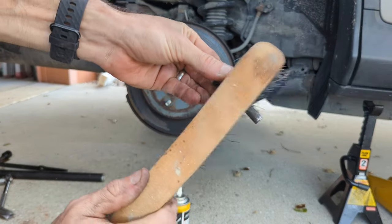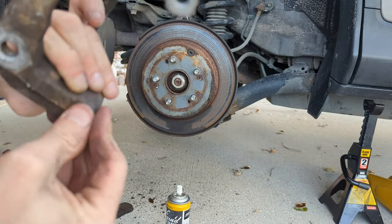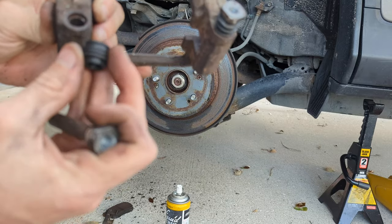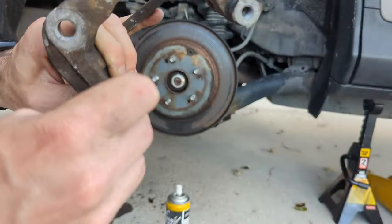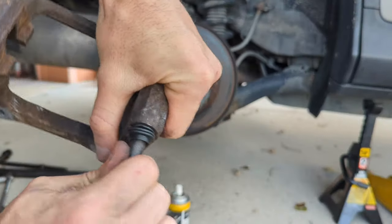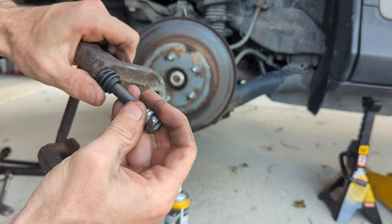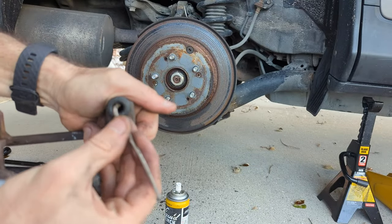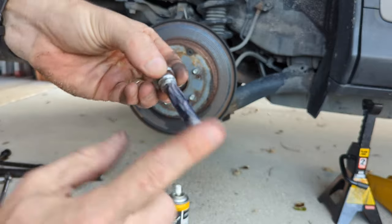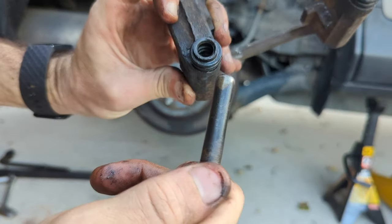So we have the pin. We're going to brush it with a wire brush to remove more corrosion. You should be able to get a replacement boot in with some persuasion — there is a little lip in there, so you match the part with the lip and press it in, rotating it around. Something like an O-ring tool would be nice, but just rotating and pressing works. With some persuasion and pressing with a stick around the sides — a toothpick or O-ring pick would be ideal — we were able to get it to seat. Then we got some lubricant over the counter to keep it from seizing.